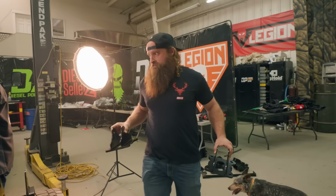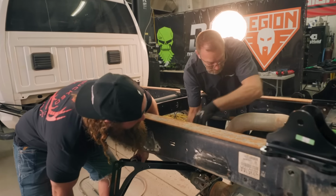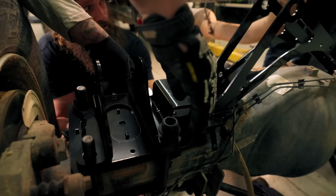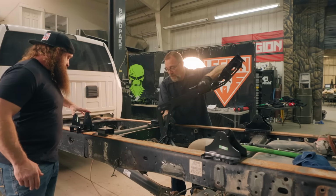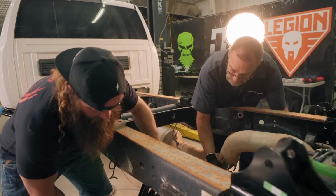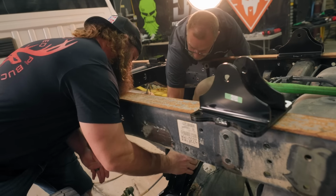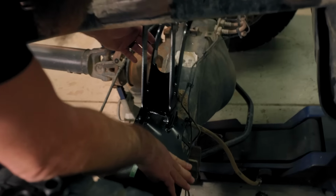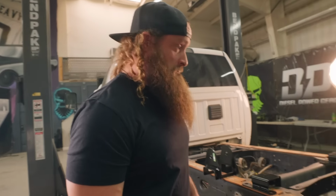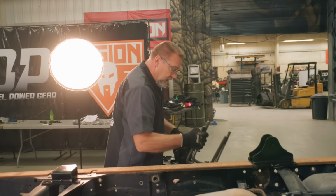So yeah, we'll just start with the axle and do that assembly first, and get all the parts on there. The bridge, axle clamp group is what we call it. And then from there, we'll build up, keep everything out of our way. Sounds good. All right, let's start with this one. Go underneath first, over on top of the axle, and then it locks in. That will lock into this tab. Got it. So we're even right to left. First will be these guys. Okay. And then they're going to go underneath, and then our U-bolts come from the bottom up.